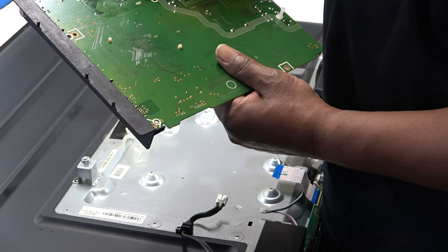Okay, that's the other capacitor. 9.2. Just say 9.2 microfarads, okay? Now, when we put these in, I know I said this once, but I have to say it again. Make sure the polarities are correct. This is negative, okay? That goes this shaded side right here. See the other side? Where the other pin is plain. Okay, that's always positive.